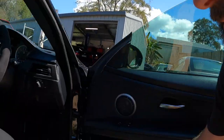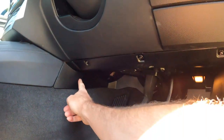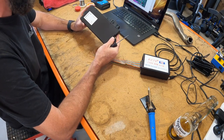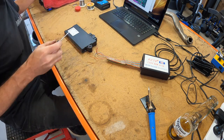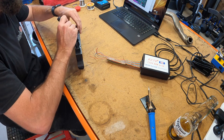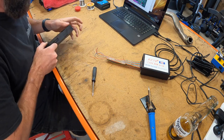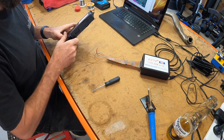It's really hard to film getting the CAS module out so I'm going to crack on with that and you'll see me back on the bench once we've got it out. For anyone actually following this as a DIY — which I really wouldn't recommend — it's those three Torx bits and some cars have a pin. This one doesn't have it, and then there's a 10 mil bolt which holds the CAS in just up there.